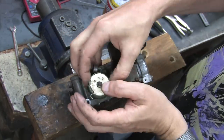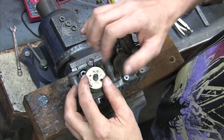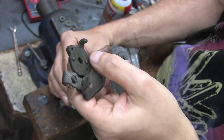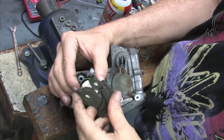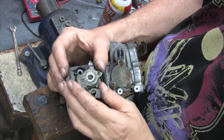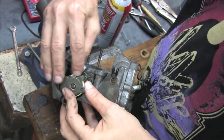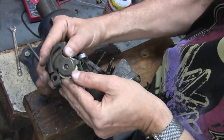And the plastic sandwich separator thing has two holes in it on opposite sides. Notice the center bore of the plastic piece is round so it can rotate freely. And it's the metal throttle linkage that's slotted and has two nubs that help you align the plastic separator thing once it's all assembled. There's also a part protruding from the throttle linkage twin spring ends. Don't worry about which one goes where right now. Wind the assembly between 1¾ and 2 times.